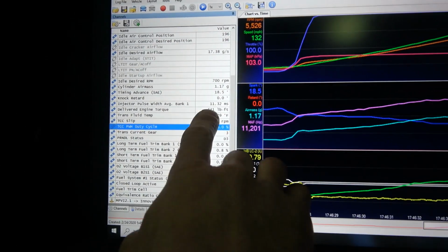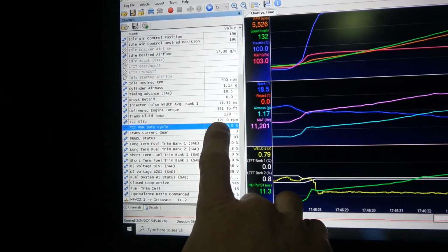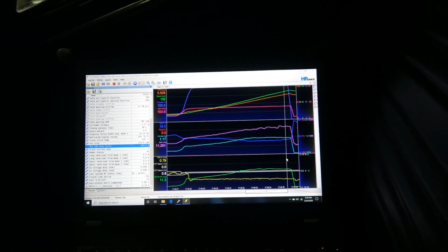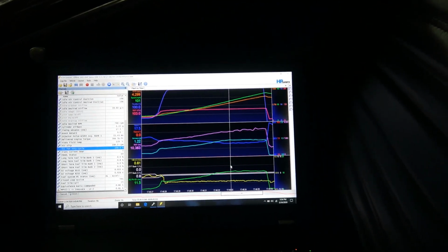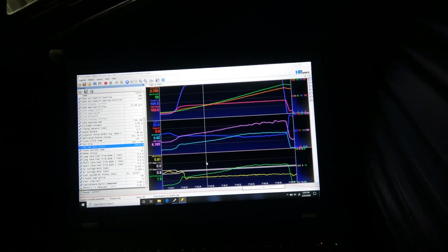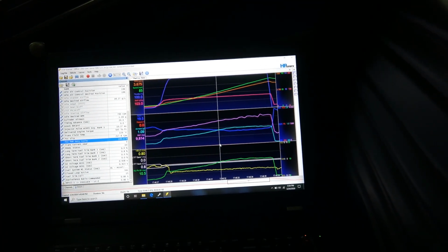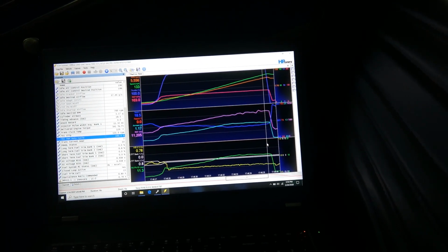At the top, I'm only slipping as the engine winds out and the torque converter starts to couple up as RPM builds, but it's still slipping. So we're probably losing 30 to 40 horsepower from what we're reading at the rear tire. I've talked about that in some of my other videos. When you don't lock up a torque converter on the dyno, it can really skew results. I shouldn't say skew results, but it can just read lower, because some of that power is being sapped up by the torque converter.